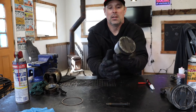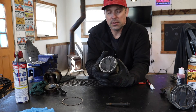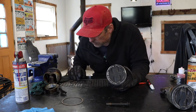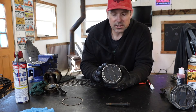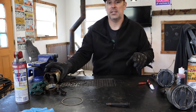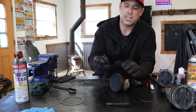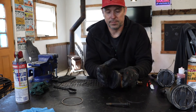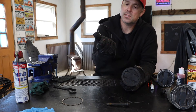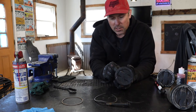Today I've been working on cleaning up these pistons - tried to clean up the excess carbon and stuff off them the best I could. I'm replacing the piston rings, I've got all new piston rings that I'm putting in. I've got five of them done and just one more to go. Some of these piston rings basically just crumble in my hand as I start to take them off - they're not flexible at all anymore. The top one was still flexible but that middle one was pretty brittle. Watch your eyes with these things if they break.